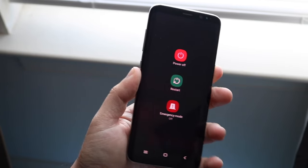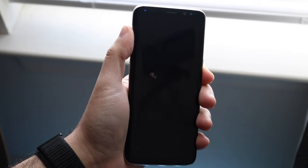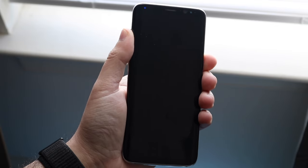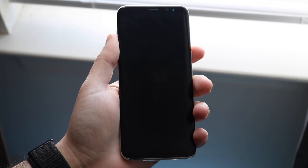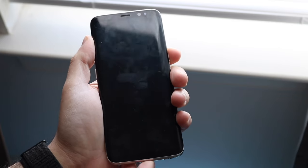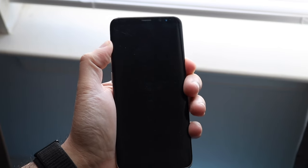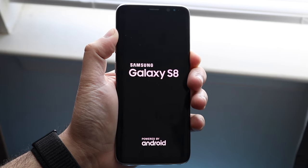So I'll go ahead and try turning off my phone here. Pretty much what I had to do was hold down the volume up button and the power button at the same time, but only after I plugged it into charge. Once the phone was fully powered off — typically when I unplugged it, it was powering off and not allowing me to do anything else — what I had to do was, as I plugged in my charger at the bottom, hold the power button and the volume up button at the same time until the phone got into its reboot panel.